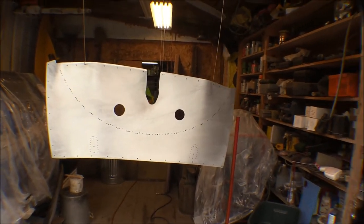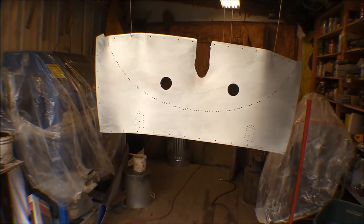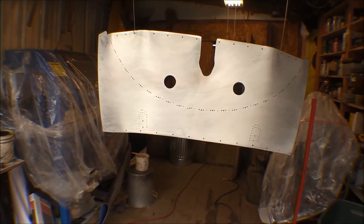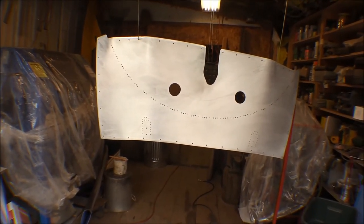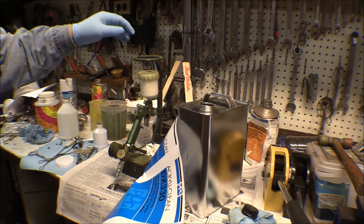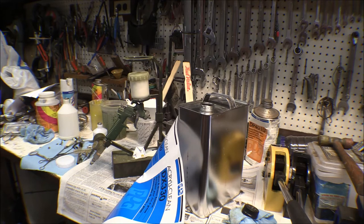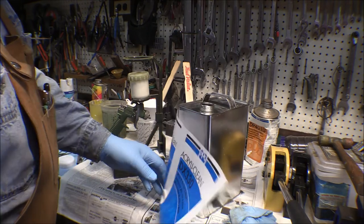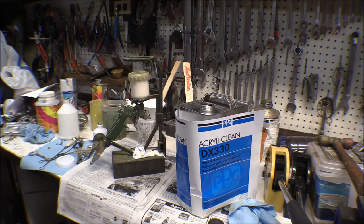Here's the boot cowl top — I've got it hanging from the ceiling in the shop, getting ready to paint it with primer. I just brought it out and wiped it down once with some prep solvent, then got another clean rag and wiped it down one more time. You have to let it dry pretty well after wiping with prep solvent or the paint won't stick well. Now here's my paint setup — a little SATA mini HVLP gun. I've had this for about 20 years. It's a really nice gun that lays out a really nice pattern. I didn't use it before because I was using my Harbor Freight stuff, and the Harbor Freight stuff is actually adequate.